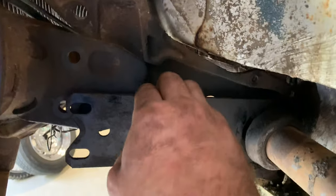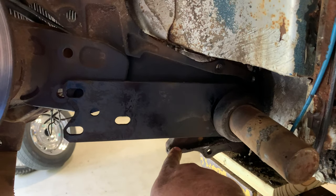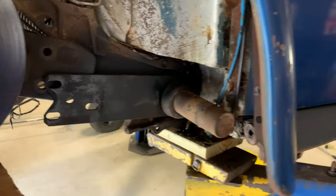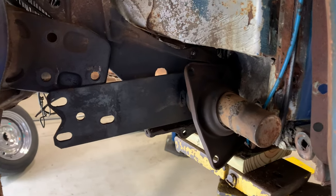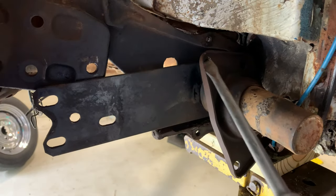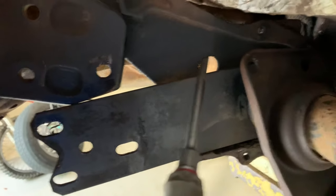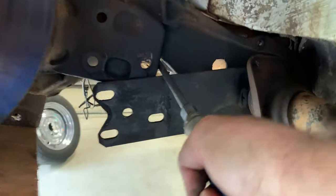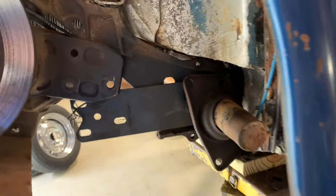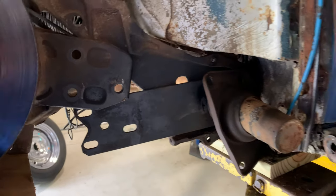We're going to pull it back down to where it was — it's up fairly high. Some people would just bring it from here to just a little bit to drop slightly, but this is going to drop a significant amount. I decided to go two splines instead of three on the outer one. Now I just got to get this plate down enough for it to drop back in. There we go — that is set. Now we can drop the axle back down, bolt everything back up, and put the shock on.